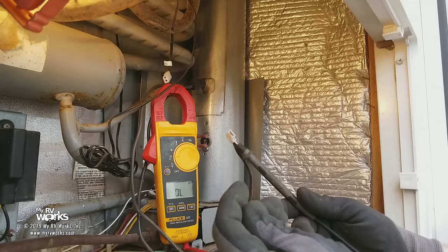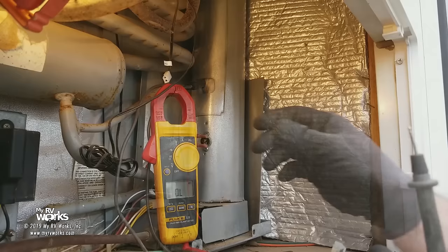So let's pretend that we didn't get that value — that this was open, as if the wire was broken or the heating element had failed on the inside. We're plugged in, our heating element has failed us. We're supposed to get 44 ohms and we're getting none. Well, we're going to have to replace it. Let's get busy.